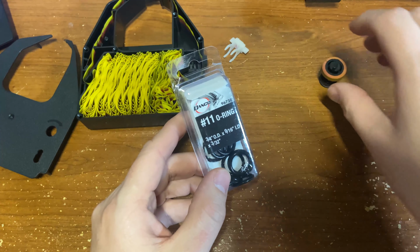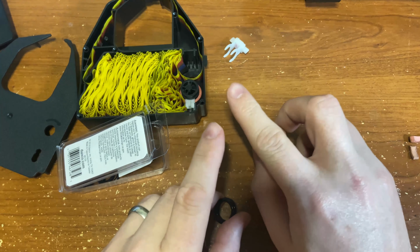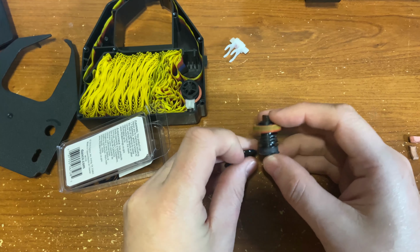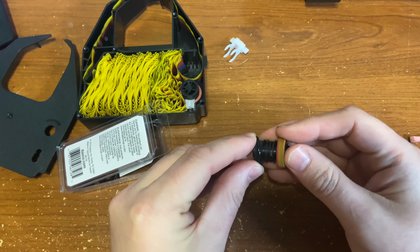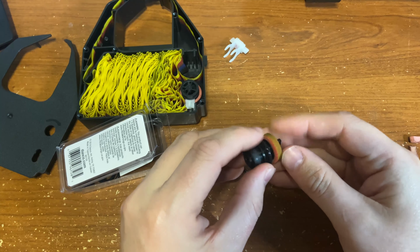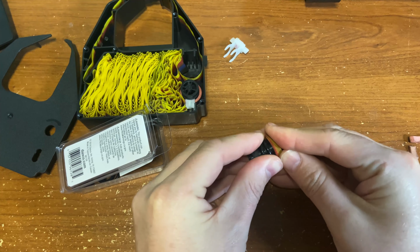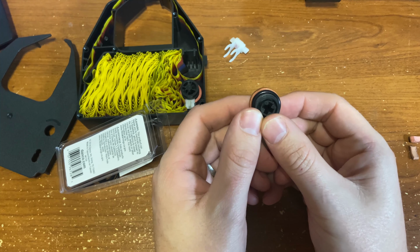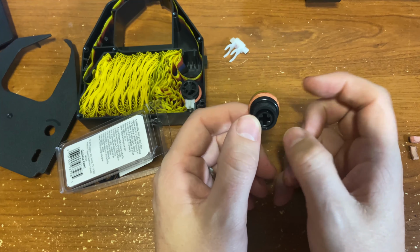Now, as I said, each of these rollers, depending on the manufacturer, is slightly different. For this one, I think it's a Quill brand. Each rubber roller will get replaced with 2 O-rings. So I'm going to slide this onto the middle while we keep that top one on, just so you can see that there is definitely a size difference, but it's manageable. If you look, yeah, the original rubber is slightly larger.